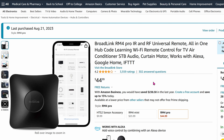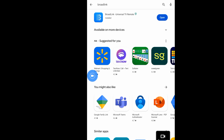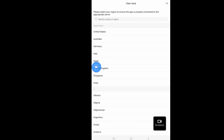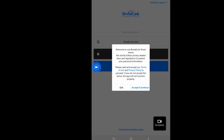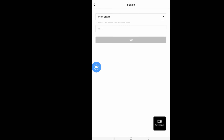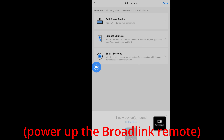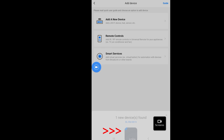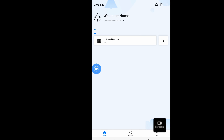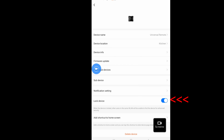That way you're making sure this device will never get online and it's all local. The first thing you want to do is install the Broadlink app, download it and open it. Unfortunately you need this app to get the device onto your Wi-Fi network. Once it's on your Wi-Fi network you can block it from ever getting online. After installing, sign in or sign up for an account. It will automatically find the new device — click on it, click again, then join, and enter your Wi-Fi SSID and password. Once done, click on the device, tap the three dots in the upper right corner, and confirm that Lock Device is unchecked, otherwise it will not integrate into Home Assistant.